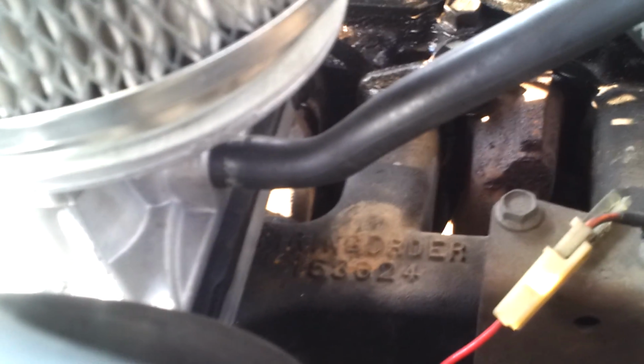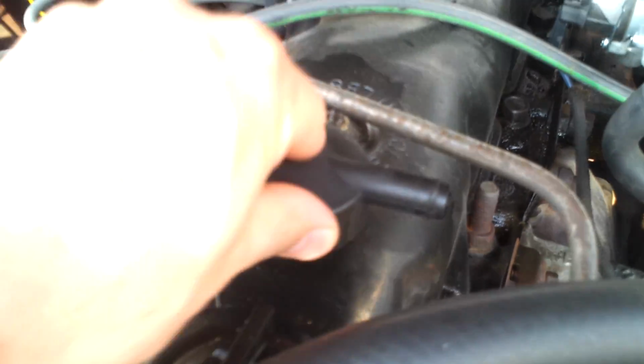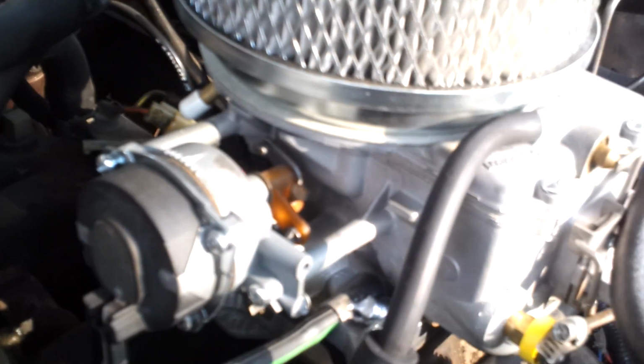and that one, the PCV valve, comes off and plugs into the back of your carb back there. And then I put in that little breather thing that Gronk puts in his carb kits up here, and I believe this one is supposed to have a hose that will come in and connect to this one that's plugged in the back of the carb there. I was talking with Gronk and he said it doesn't really need that hose. It's just like a breather hose, I think.